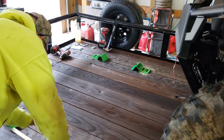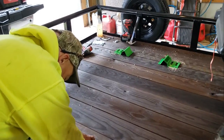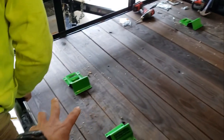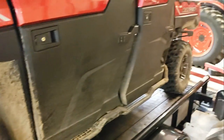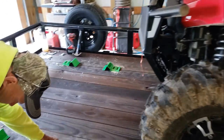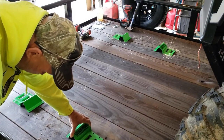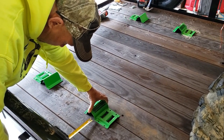So the buggy was a little canted, so what we're going to do is basically square it all up. That one's correct on that tire, so we're just going to match it up on this side with measurements. Then we got to slide this back end over to get it to fit right for the back too. We're putting larger bolts in now — nuts and lock washers — so it's going to be probably twice as strong as what it was from the factory.